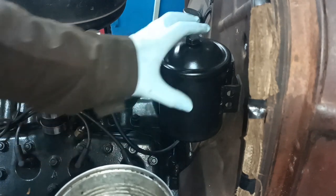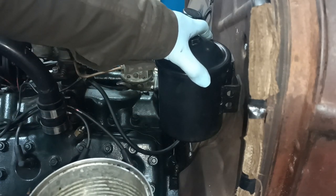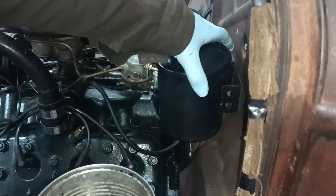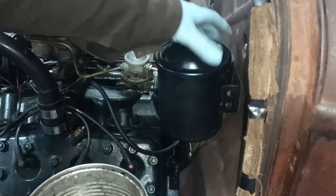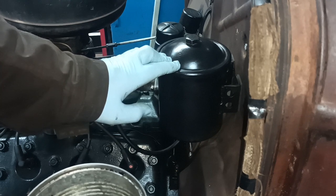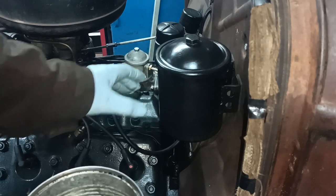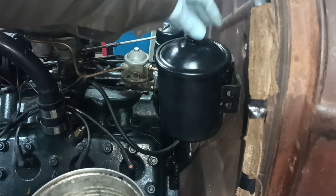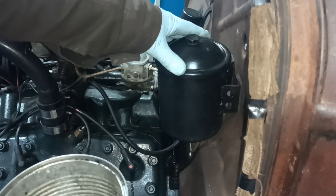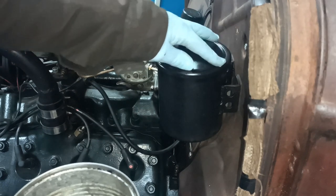But physically, height, diameter of the inside, and physical construction, it does look like a good substitute. This is what was used on the Mercedes-Benz cars in the early 60s, what they call the Heckflosse or the fin tail. So there is a reasonable availability, and I think they're used on a lot of trucks as well. There's list upon list upon list of cross references for different part numbers. So, if that proves serviceable, other than the fact that the O-ring isn't really a great thing for this application, for less than a tenner, that's a good substitute for people that don't live in America.